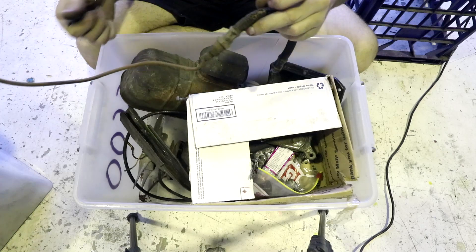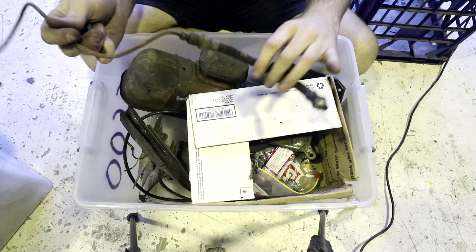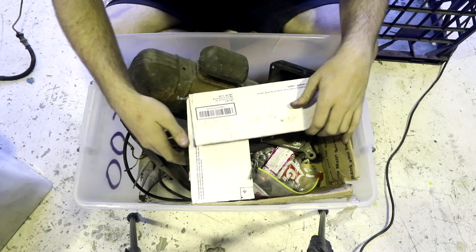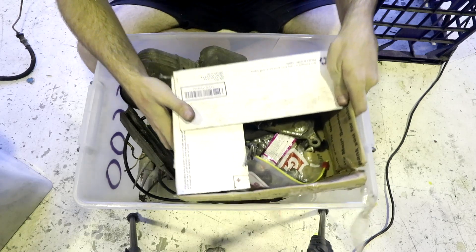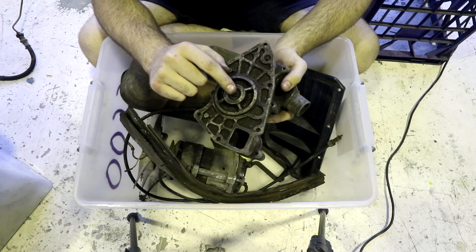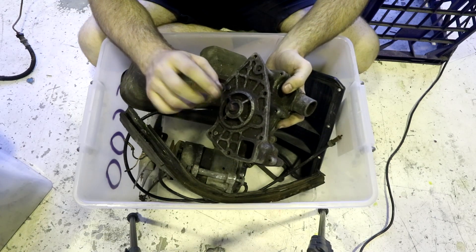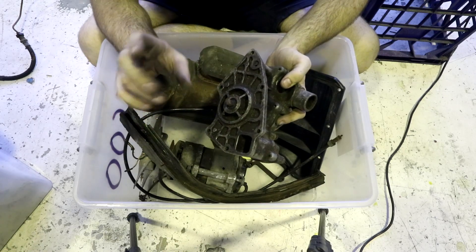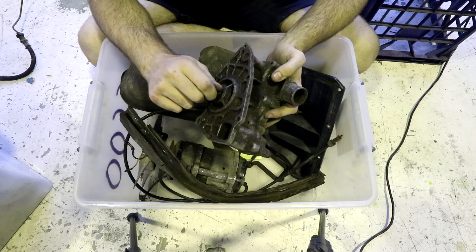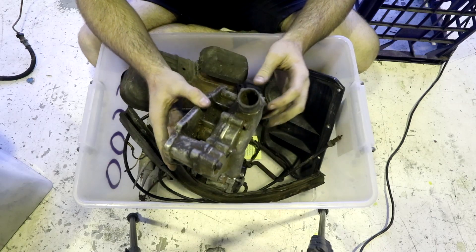See, this is why we don't use original brake lines. I'm pretty sure this is the clutch line — I'm going to take a guess and call this one the clutch line. We'll put this box aside and dig into this box in a minute. That is the water pump. This little flat tang on here — that would match up with the back of one of those shock-absorbed gears from before. So I'm guessing one of those gears drives off the timing chain, and that's what drives the water pump. That's what they've got this tang for, to take up any misalignment. I'll mark that down as water pump.